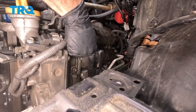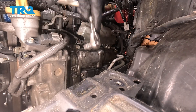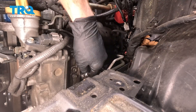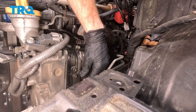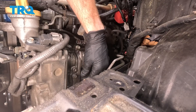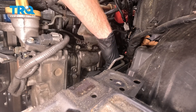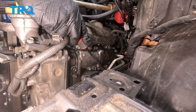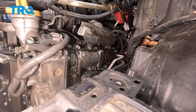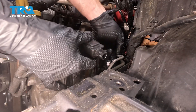We're going to focus on our ignition coils next. Typically, you disconnect the electrical connector first, but in this instance it's easiest to remove this if you dislodge the ignition coil first. I'm just using a 10 millimeter for the one mounting bolt — there's one bolt for each ignition coil. The ignition coil should be able to move around and start sliding away from the engine. Now for that electrical connector, it does have a locking tab — it's this metal tab right here. You just want to press it towards the electrical connector and you should be able to dislodge it. Once you do have it dislodged, a quick inspection for corrosion. Remove the ignition coil from the vehicle.